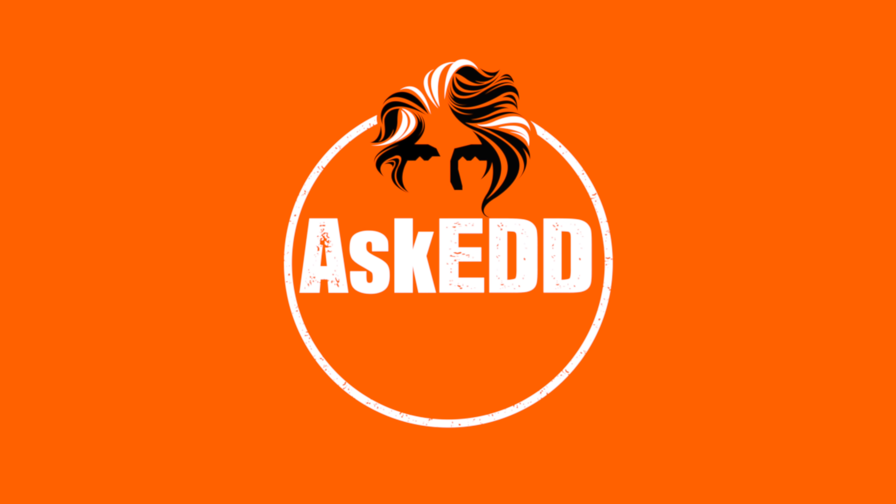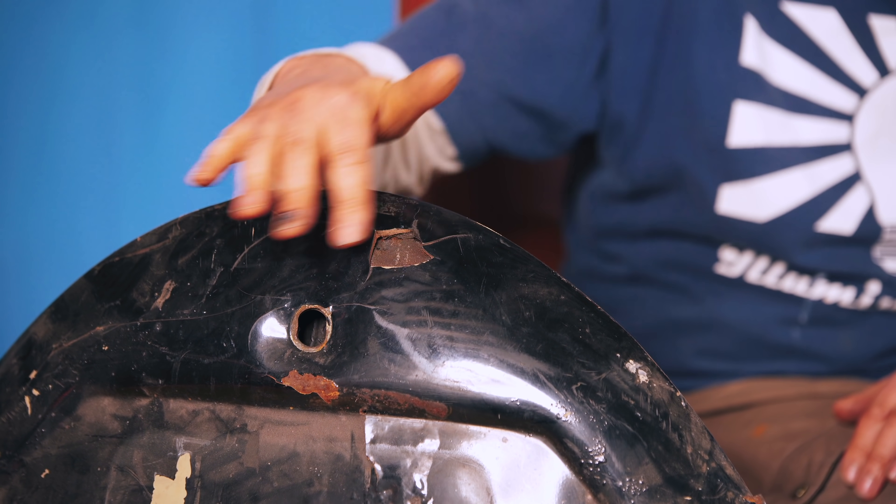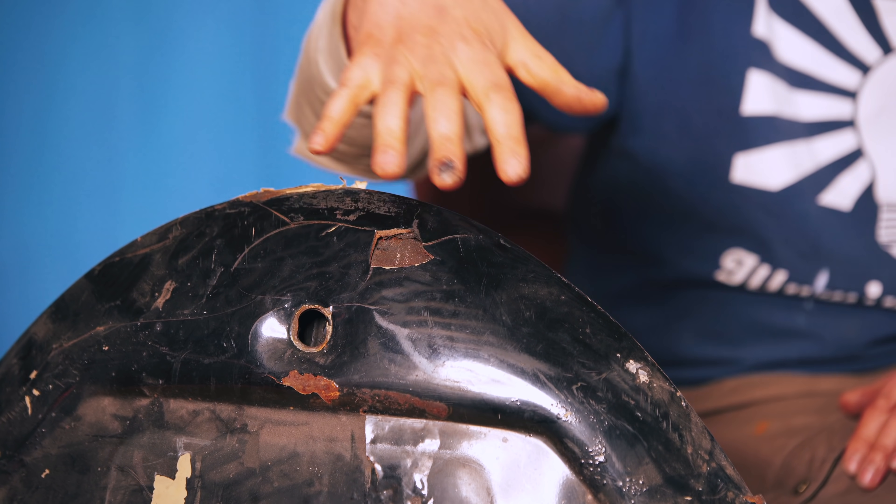I've just got time to squeeze in a couple of questions. The first one is from Lindsay — any tips for getting pattern panels to fit? When it comes to pattern panels, you get what you pay for. The cheaper panels are cheap usually because the tooling is worn, which means the panels aren't going to fit as well. Always go for the best quality ones you can afford. Don't feel obliged to use all of the panel you buy — cut out all of the rotten metal, get your ideal hole, then use that as the guide for what you want to remove from the pattern panel, saving the rest for other patches. That way you minimise the work on the panel but also maximise the amount of original car you get to retain. That's a win-win.